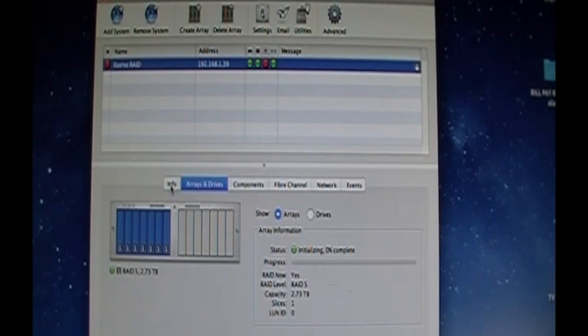I really hope this solves the crazy issues I was having with the controller. All these errors. It was working, but it wasn't fast. It was like bursts of speed. You'd see the drive kind of queuing up. The blue light would be on a single drive, not evenly across the RAID, like the parity was all screwed up, and then you get all these crazy command errors, like I mentioned in my previous video.